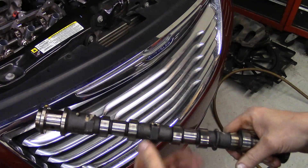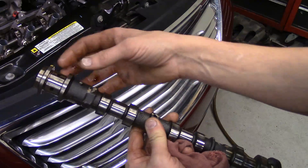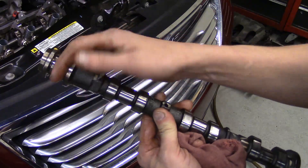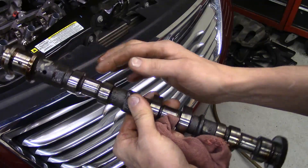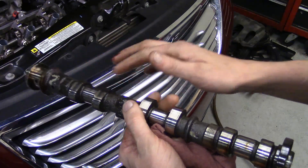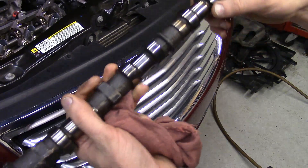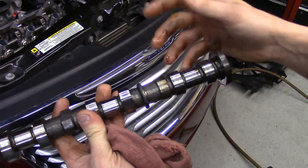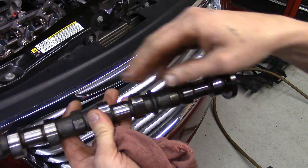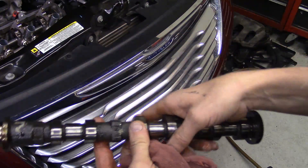While you've got the camshaft out, pay extra attention to the lobes and bearing surfaces. Make sure you don't see any deep scoring or issues related to lubrication. Make sure all the cam lobes are nice and rounded and uniform — no rounded-off edges that have been damaged where the roller rocker needle bearings have gone out and locked up. Make sure everything looks good, then move on to the other one and inspect your valvetrain as well.